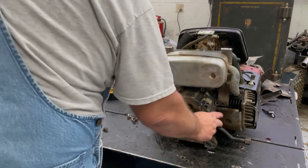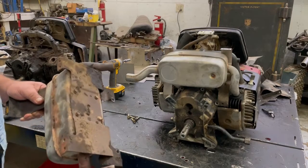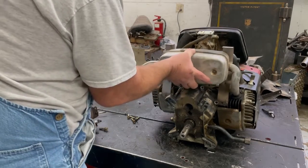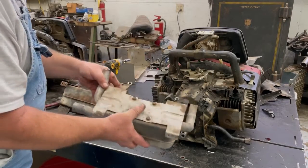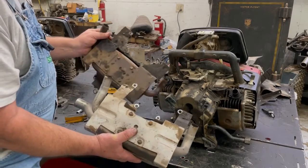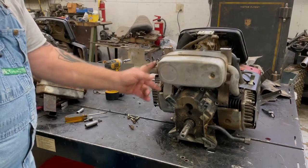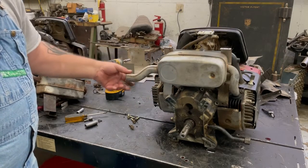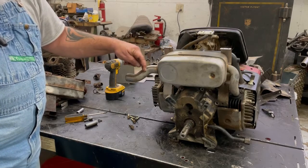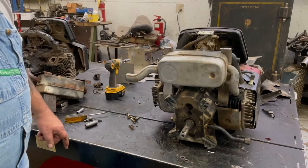Well, I got the dipstick on there and stuff, and I got the spacer and the cube on there, but I can't use the muffler off the old motor because the governor assembly is different. On this one here, how it's indented in because the governor assembly sits down lower than that one there. So what I was thinking, this is bent down and out. I was thinking about cutting it, turn it 180 degrees so it's up and back so it don't hit the hood, it don't hit the frame, because the frame is about like right here and it goes up like about a ½ inch. So I was thinking about cutting it and bringing it up and out to the back. So that's what I'm gonna do next.